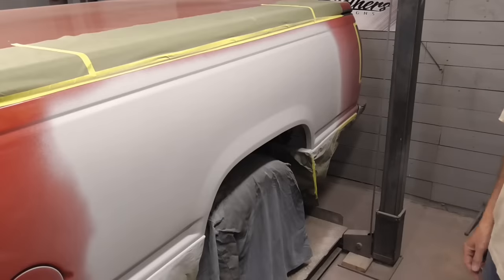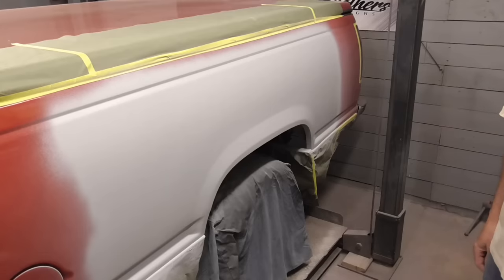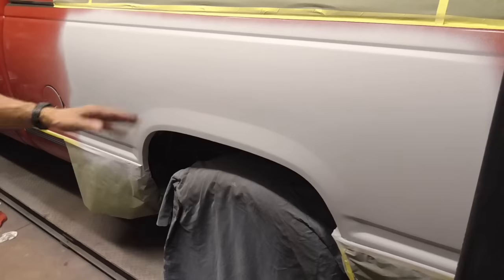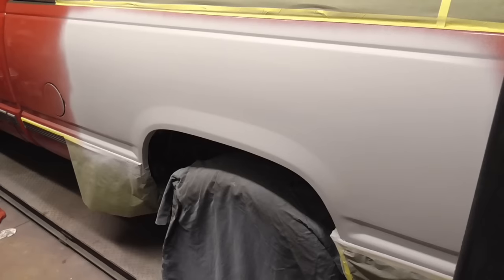After feather edging the old paint and finishing our filler with 80 grit, we gave it 3 coats of feather fill primer surfacer, and this is the finished panel, ready to be block sanded, primed again, finished sanded, and painted. If you're concerned with the integrity of the patch panel seams and the longevity of the repair, this may be the best way to go.